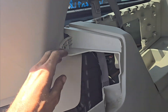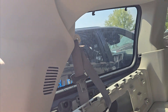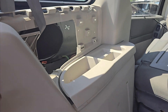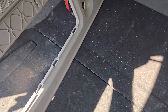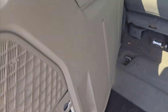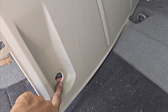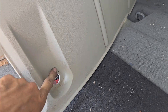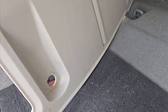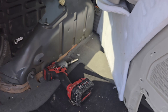This is also the power lift gate area, so all this panel just sits flush over top of here. You'll have to pry out on this and pop it loose all the way over, and then the cover over the seat belt you'll have to remove as well. This is all just held in with clips, so there's no real sense you're going to break anything. I also removed the seat belt anchor down here — this is a 21 millimeter — and used the impact to remove that so I could get the seat belt out of the way.